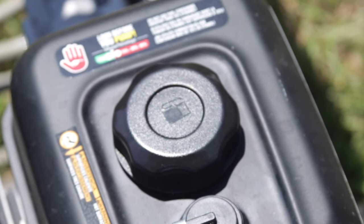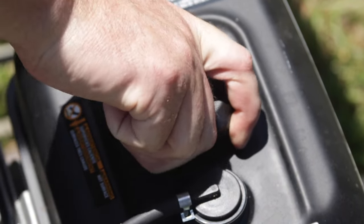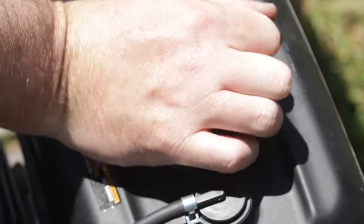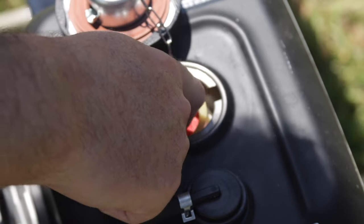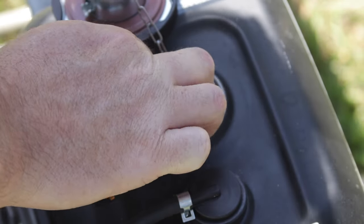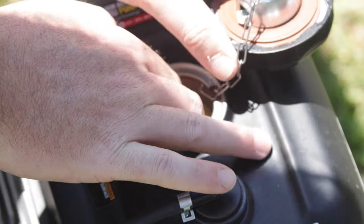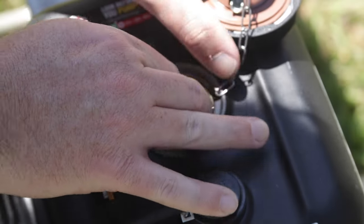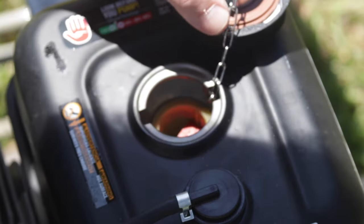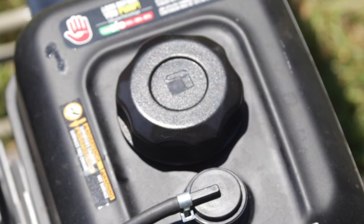Next, make sure there's fuel in the fuel tank. If your fuel has been sitting over the winter, it can go bad. If you want to prevent this, you can use fuel stabilizers, or a lot of times people use higher octane fuel if they're going to leave it for a few months. The easiest way to deal with bad fuel is to just mix in some good, high-quality premium fuel at about a four-to-one ratio — pour it in, shake everything to mix the gas, and the higher-quality fuel will help burn off the older fuel.